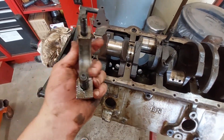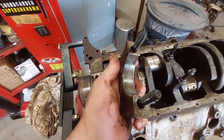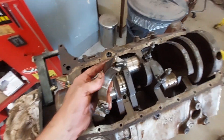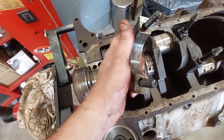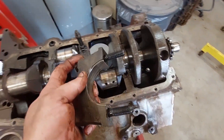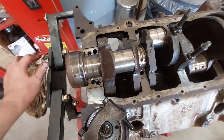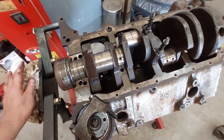Here's the number one main cap. The bearings aren't bad — they're not pristine. My son and I pulled apart the engine in his Crown Vic a couple months back and you could still see the machine work in the bearings. His car got a brand new engine before it was retired from the police force. We ended up putting it back together with the stock bearings. This one here — there's no copper showing, the bearing seems to be thick enough. Whenever I put this engine together I'm going to plastiguage these bearings. I may just wipe them down, and if I feel froggy, I might put some emery cloth on them to get rid of some of the pitting, but that's not going to destroy the crank or cause your engine to blow.